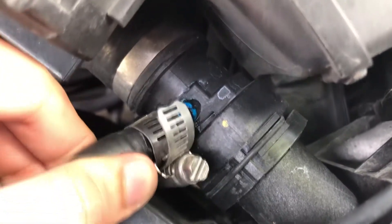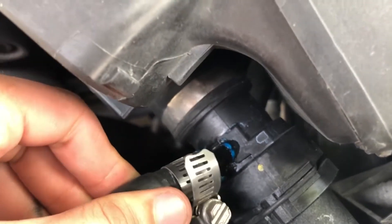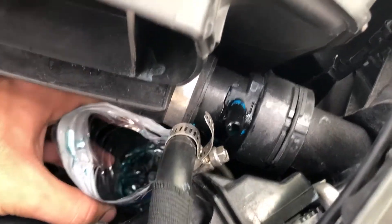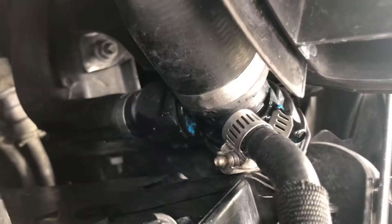I'm going to slowly twist it out — very easy. Don't turn it sideways because you might risk breaking off the nipple. We're going to see if any coolant seeps out. I got myself a water bottle, cut off the top, and just let it drain a bit. Basically almost nothing came out — this is what you want, doing this on a cold car. If you pressurize the system while it's hot, coolant is going to fly out. Almost nothing came out, but better safe than sorry. You can see all the blue residue that was falling down the hose.